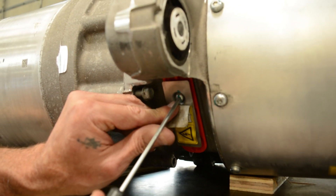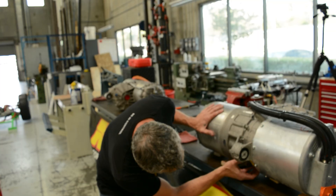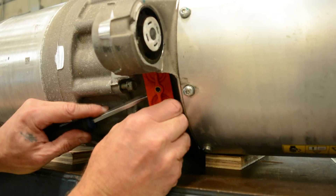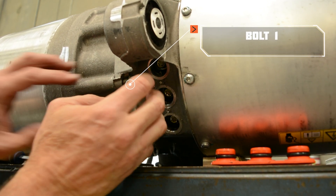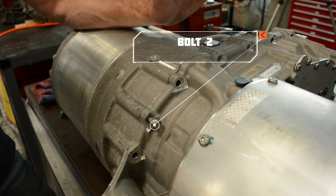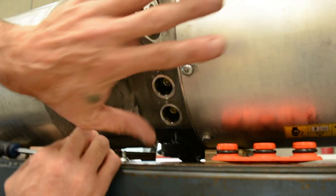Before you get it apart, you have your high-tension bars — your three phases that run from your inverter over to your motor. That's stashed behind that cool little orange plug that everyone always sees. I'm going to pull that off and show you what's behind it. You have your three high-voltage phase cables coming across. You'll notice there's a bolt here; all the case bolts are out already. We are going to split the case to change the limited slip diff, but there are two bolts still in here. First off, you have to take these three bolts out in order to split.